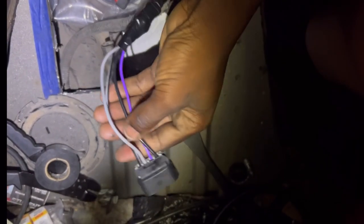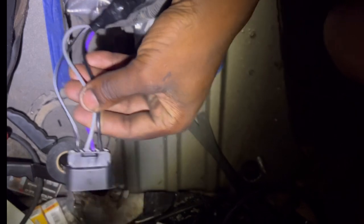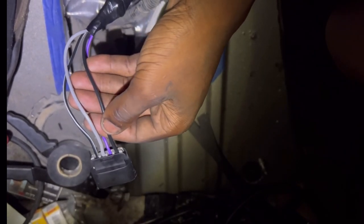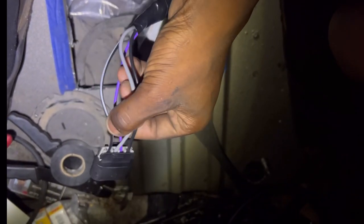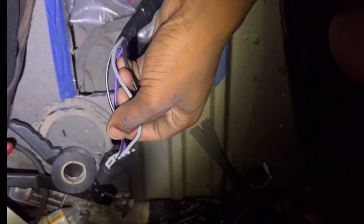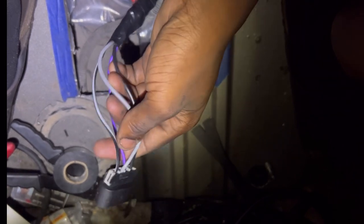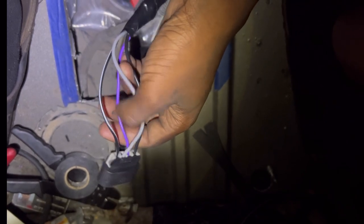This is the four-pin connector — black and gray, thick gauge wire. You can tell the difference by the feel and thickness of it. The two big ones are for your fuel pump — one for power and one for ground — and the other two are for your fuel level sensor to tell you how much fuel you've got. It's pretty self-explanatory and easy. I heard you can mess up the wiring just by having one wire mixed up, but I haven't had that issue. This is the finished product, but I ended up tearing it back apart to recheck it — which y'all will see if you stay tuned.